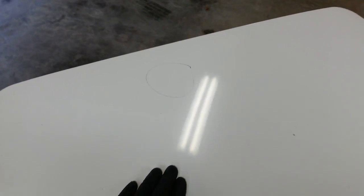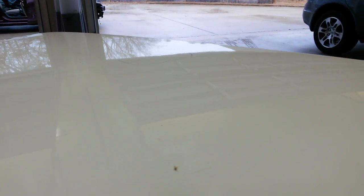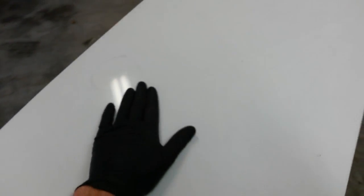The customer came by and dropped off some more parts. I've got the other bumpers and stuff still outside but I'll get those in later. This has one tiny dent — the sunroof — very, very minor. I don't think my primer is going to fill that, and I'd rather just put some filler on it anyway because I've got to sand this — it's been repainted at least once. I'm going to have to sand through this. I'll just go ahead and take down that spot and put some filler; once I get down to the original finish I'll take that spot to the metal.